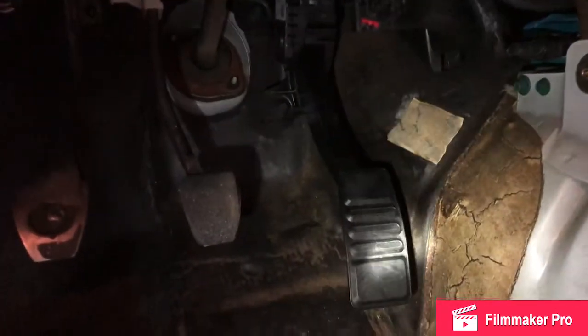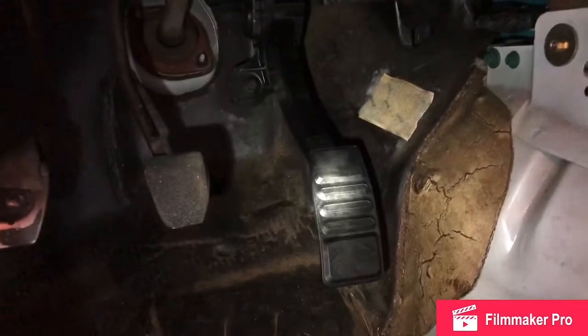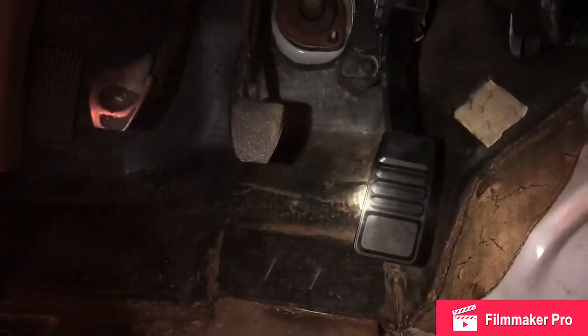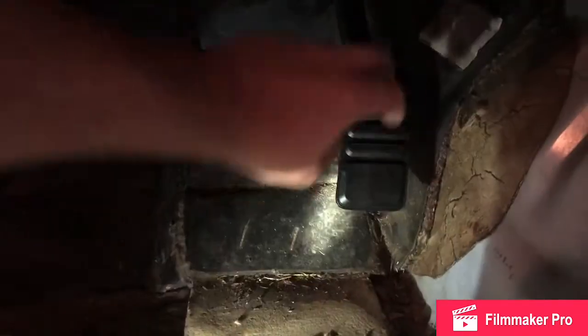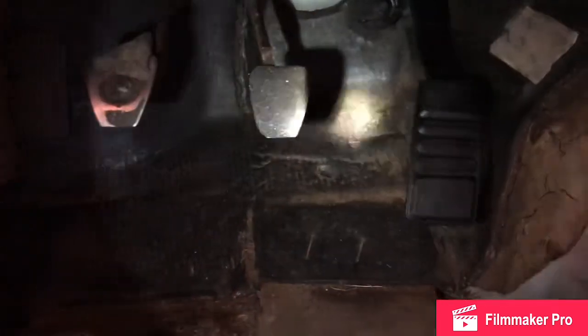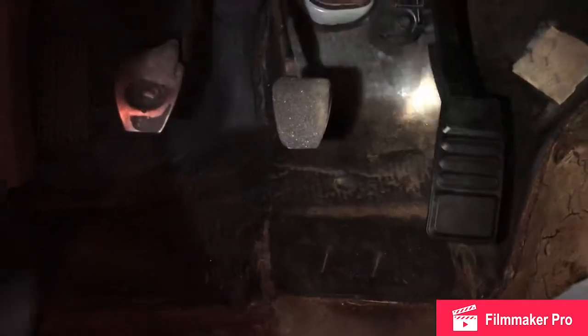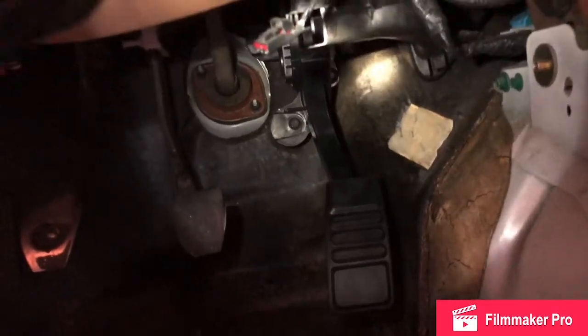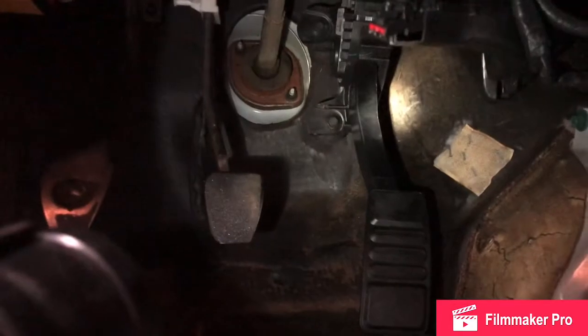Throttle pedal is up a lot — it's about the same left to right as the original, maybe a little more right. This hits the sound deadening insulation that's in here that I want to take out but I'm too lazy to. With the throttle pedal being a lot higher, I like it — I think it's going to make heel-toe a lot easier, which would be cool for race car activities. The right way to do this is probably to pull all the sound deadening out and mount the Scram Speed bracket back to the firewall itself, giving more real estate to mash the go-go maker.